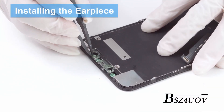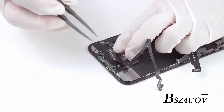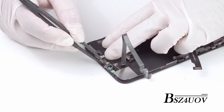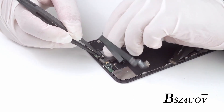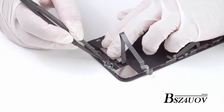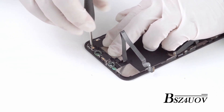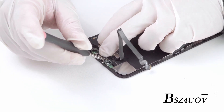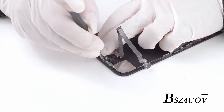Install the components. Take the little plastic holders and install them into the new screen. You don't need to glue them in — you just need to put them back into place carefully. Please be careful when putting back these ribbon cables. Make sure all of them are put in the right place. Tuck them back into the little plastic brackets and push them down into place so that they are flush with the iPhone. Then get all the screws down into the bracket and make sure it doesn't come loose.